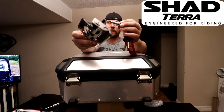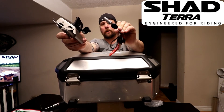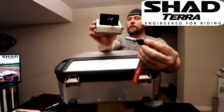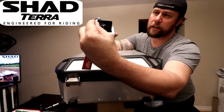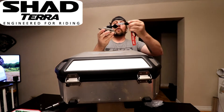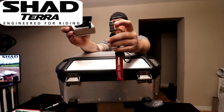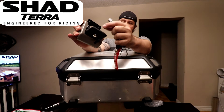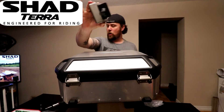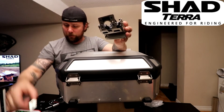Once the tumbler is in, it's in — the only way to take it apart is by removing the whole housing. Basically you put the key into the tumbler, slide it into the housing with the key oriented correctly, then pivot it 90 degrees. Once pivoted, that little woodruff key inside actually locks itself into the body housing and holds it there.